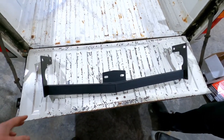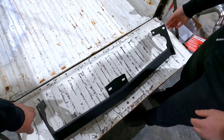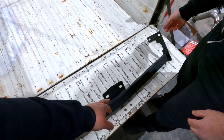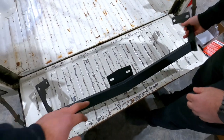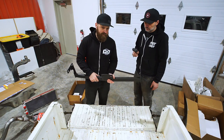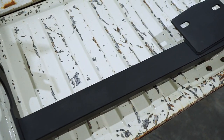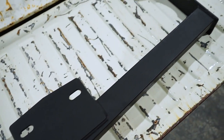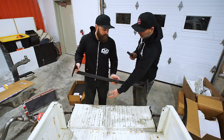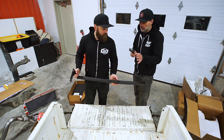Next up, the subframe mount. This basically bolts to both frame rails and gives the center mounting point, which is going to bolt in to the stock location. The stock location is basically just a rad support — it's thin metal — so I think the VR would probably rip a stock mount right out if you didn't have this reinforcement. The mount sticks way out further on the Mark 1, which isn't going to be used in this case.